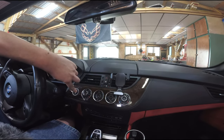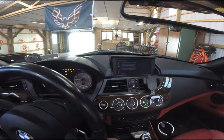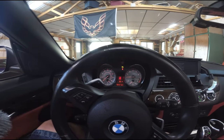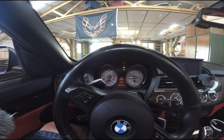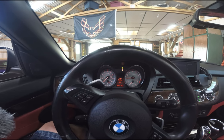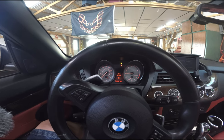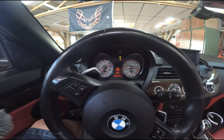I'm going to put my foot on the brake and start the car — it's in park still. Now I'm going to pump the brakes. It went to the floor, comes up. Getting harder. To the floor, not to the floor, about halfway. And now it feels like I have brakes. Feels good.